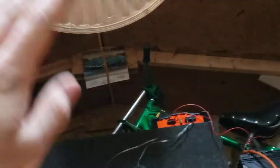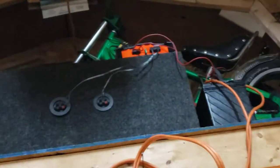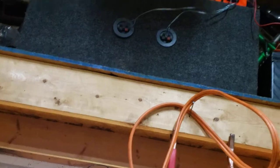Just a little Stanley trickle charger — I think they sell those at Menards also. I have the charger set up where I can just plug it into the wall and it'll charge. Like I said, I just leave mine plugged in. With it being a deep cycle battery, it's best to run the battery down then plug it back in.